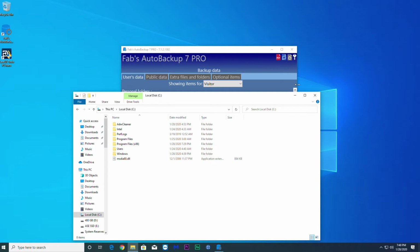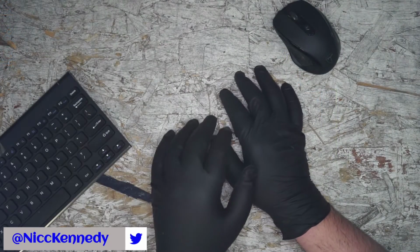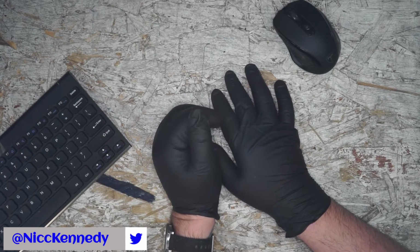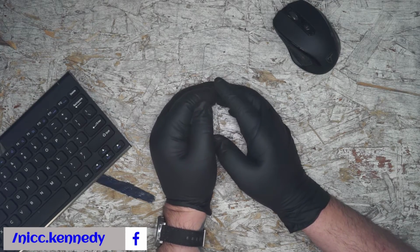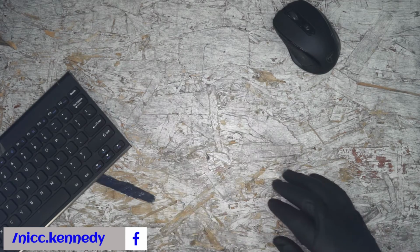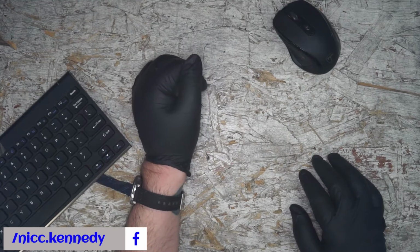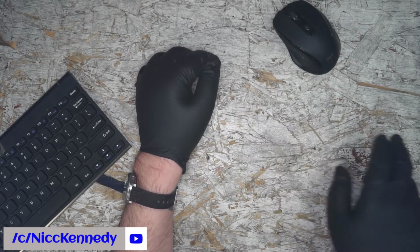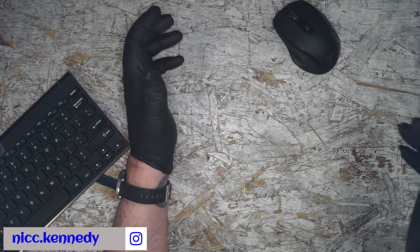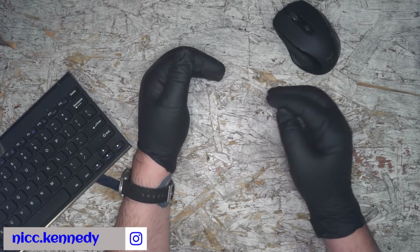If we tried to do a slight cleanup on the computer, and that had failed, trying to do a cleanup on the actual computer had failed. When we just did the basic, like Malwarebytes and a couple other utilities, even we went to the full extent on that computer, and I don't think it was so much of an infected computer thing as it was a partitioning scheme that Lenovo does, and how they have their, I think that computer did have the blue ThinkVantage button that you could press and access all your recovery functions. I think it was more of a partitioning thing. I could be wrong, but it did fail even after a full cleanup where we did a complete Windows repair.